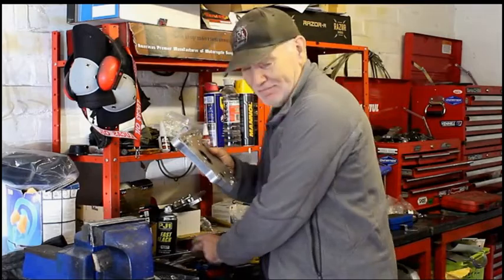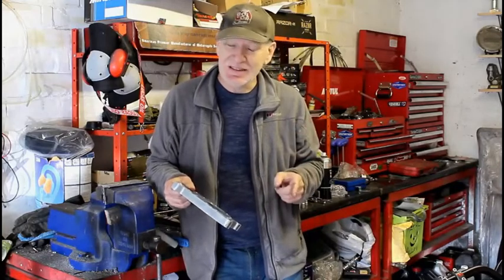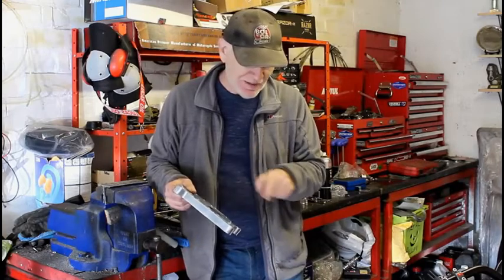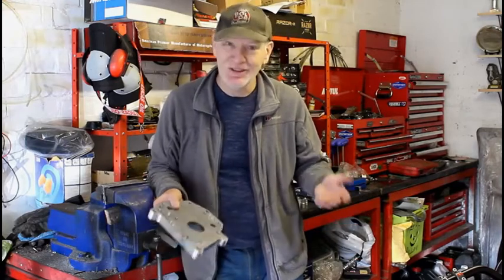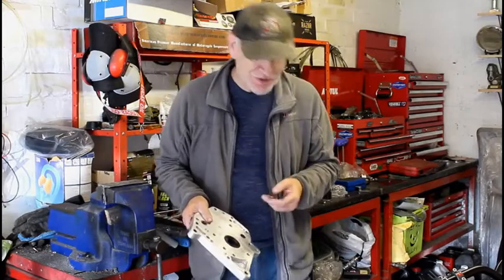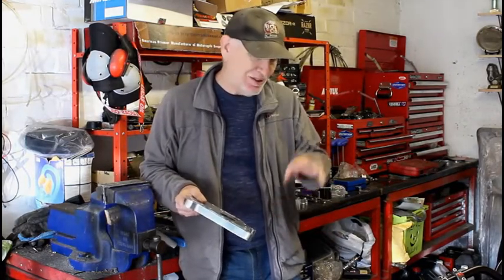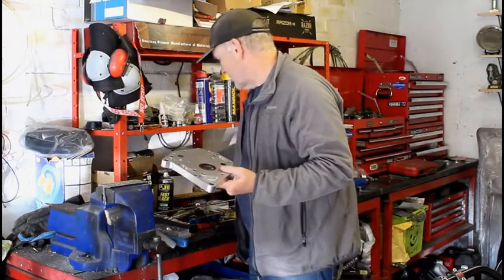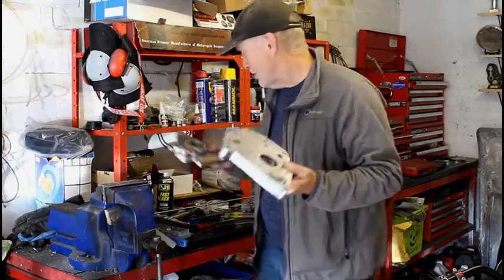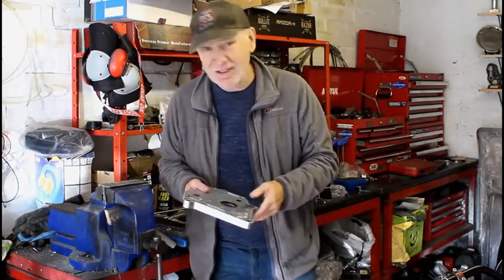And the problem is, when this is in place, I cannot get this inner plate on the bike. It just doesn't fit. And the reason it doesn't fit is because the side stand spring tang gets in the way, and that little tang sticks up, and it's where the spring goes for the side stand. And I thought, what the hell, why has this happened? What on earth is going on here? And I thought about it for a bit, and I realised that due to the COVID pandemic, probably this has never been fitted on the bike with the engine in place, because the engine was in one place and the frame was in another. And also these parts are copied from the kind of parts that Jeff makes for his drag bikes and other Kawasaki drag bikes. And guess what, drag bikes don't have side stands, so I think he didn't realise that that tang was going to get in the way.